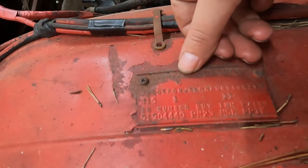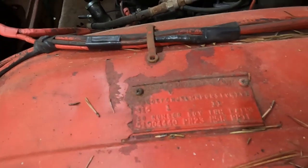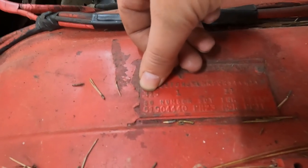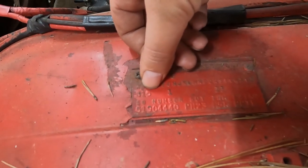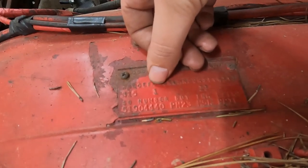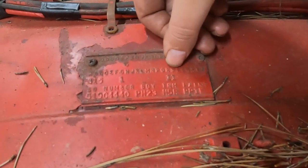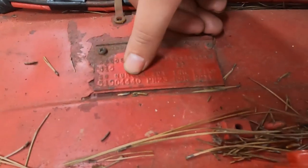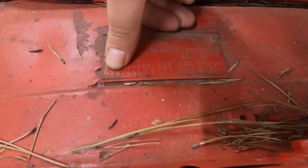So the lowercase F6 means that it has a rear seat speaker, which, surprising. The AB41 means it had a 318 two barrel. The C5 stands for an automatic transmission. G1 is a 26-inch radiator, which he was happy about because that's what we ordered. The R1 is AM radio. S1 is AC with heater. And then the SO number is the delivery number, so essentially like the car's birth date, which was May 19th.